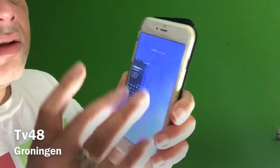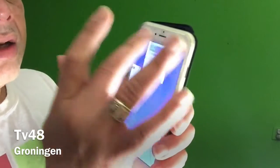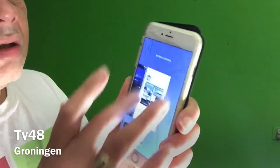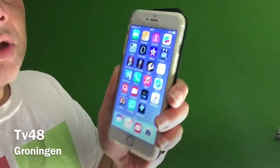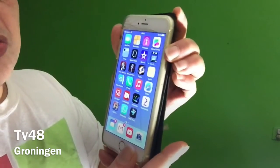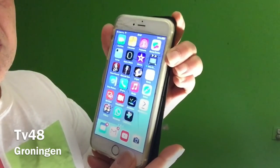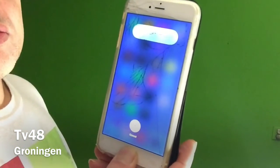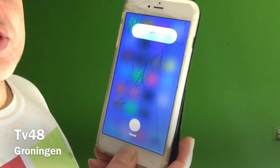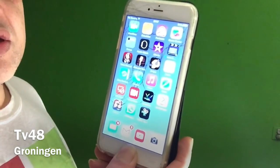Another way is to get all these apps and close them all. You can get there by double-pressing the home button — you can see we had many apps open. Then press the power button, wait for the power-off slider, and hold the home button until you're back at the home screen. That's how to free memory instantly on any iPhone.